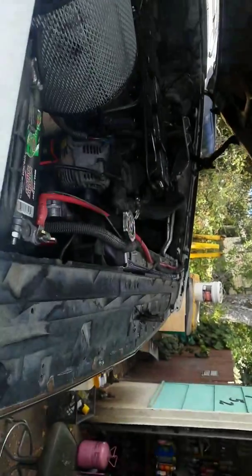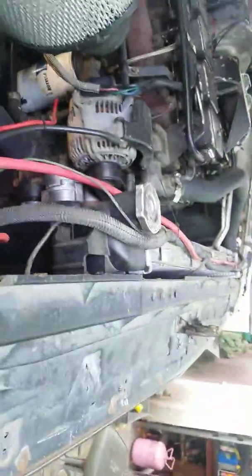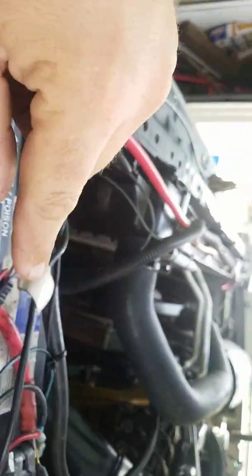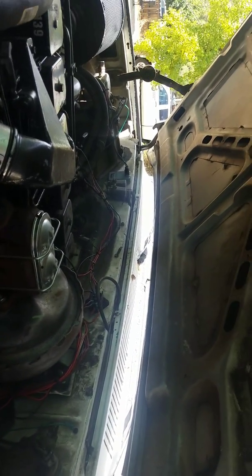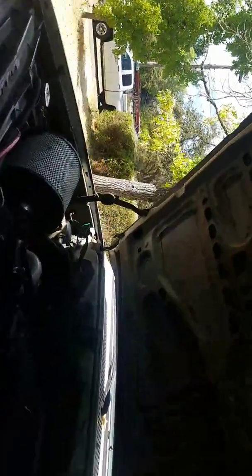I didn't have to cut the firewall. There is no fan shroud, so don't put your hands in there when it's running. Factory Dodge radiator, factory Dodge intercooler, factory transmission cooler. Got dual batteries and all of the factory wiring that ran in the engine compartment runs into the switch channel. It does still have the receiver dryer for the air conditioner, but it does not have a condenser.